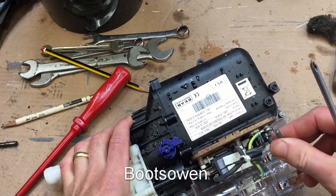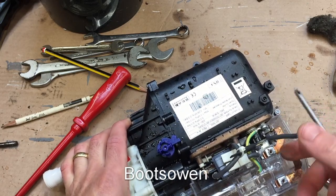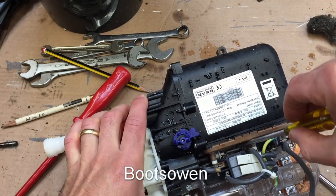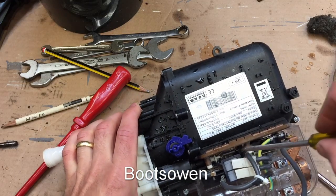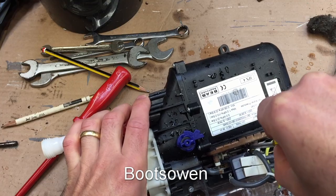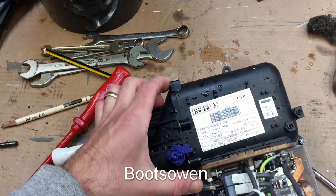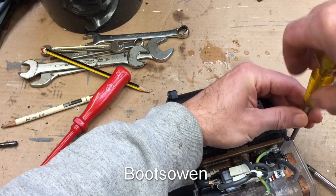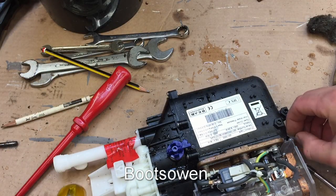That was just a dead-end cable, coming from the neutral — quite strange, just covered off there. It has two elements, two microswitches, and it has this little spring arrangement here. So there must be something — some pressure thing — to turn on those microswitches. Now if I can figure out how that works, it's a different thing.